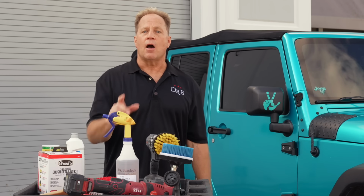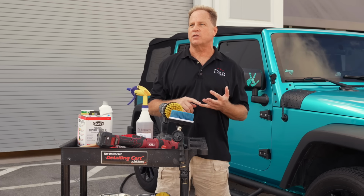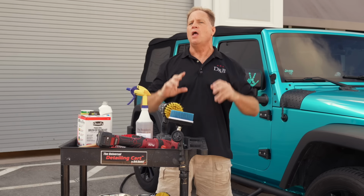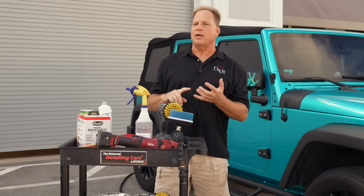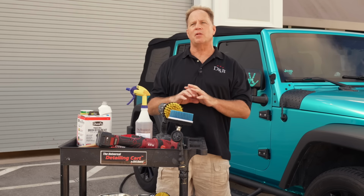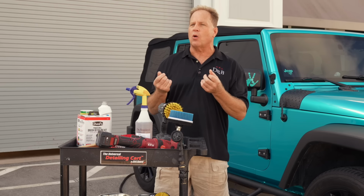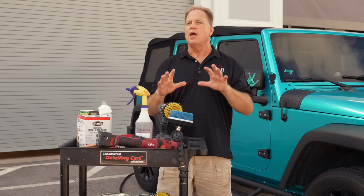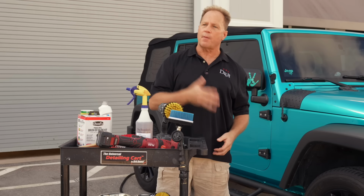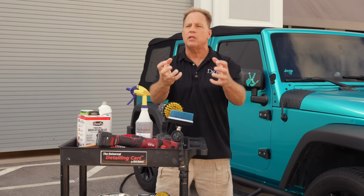Okay, now, for extremely dirty tires, I've had tires down here in my life that I've worked on that were stained with dirt. So they were driven on a dirt road, and whatever that dirt was, it's just impregnated into the rubber. And one of the worst things there is to clean are tires that have a greasy, oily tire dressing applied to them. Now, there's a huge market for tire dressings. A lot of people like that real shiny look. Me, I like a matte or satin finish. The problem with those shiny tire dressings is they're gooey or oily. And so they look cool because your tire is really black, but they become dirt magnets. So they pull all the road debris, the road dirt, the traffic film, and the brake dust onto them, trap it on the tire, makes that hard to clean off. But these products are very oily with silicone oils. And what that means is they're really hard to get off.